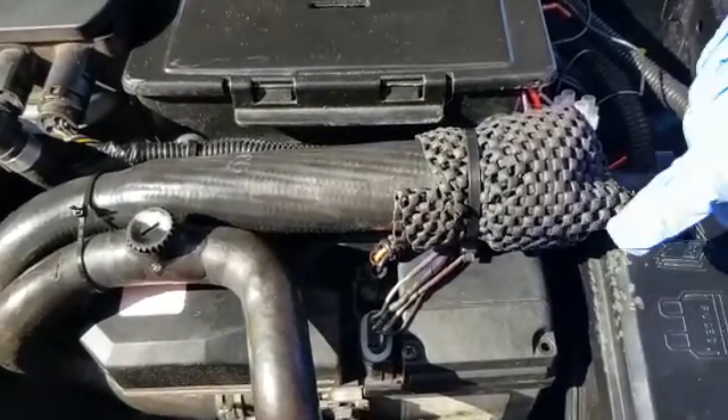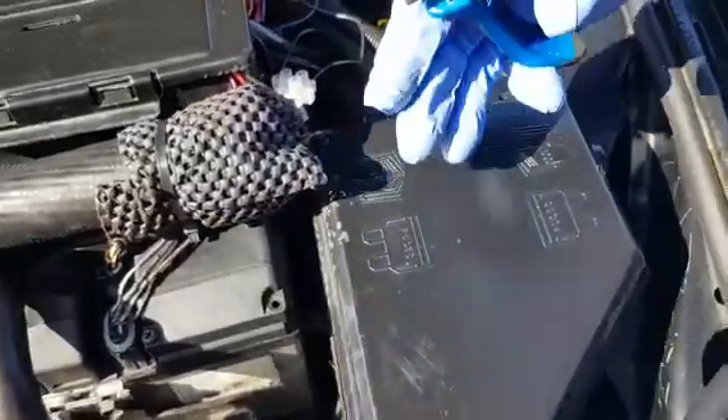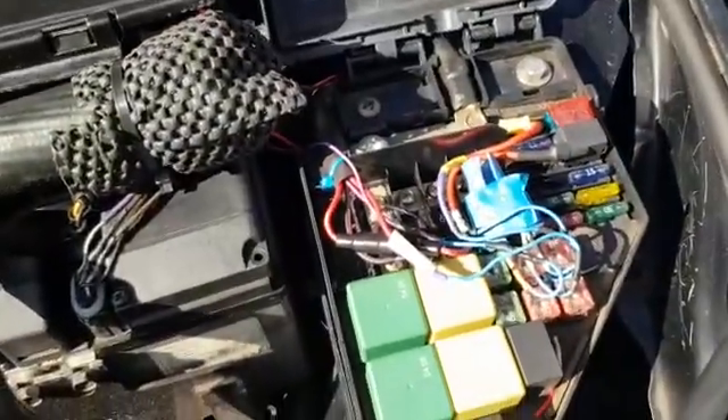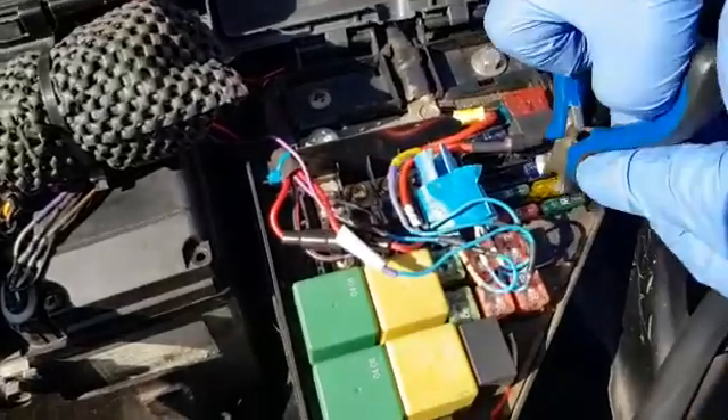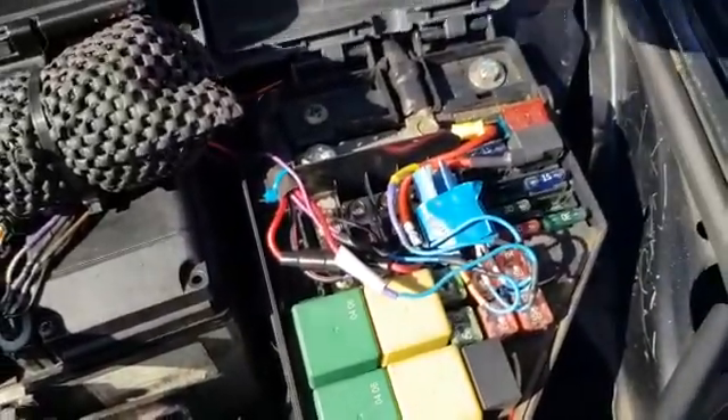The first thing you need to do is remove the fuse that's powering the FBH. On the Arriva 75, the fuse box is right next to the FBH — it's fuse number 8 and it's 20 amp. Just remove the fuse to kill the power.